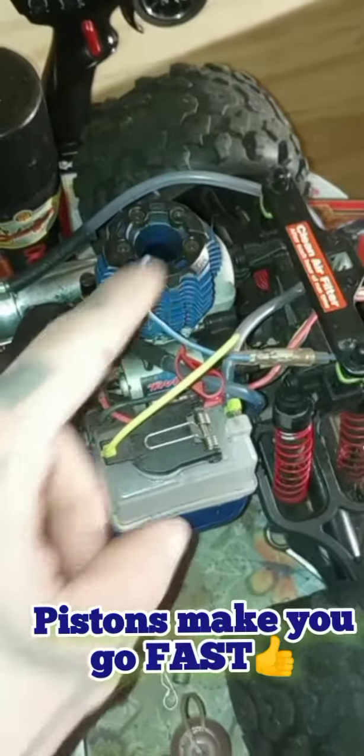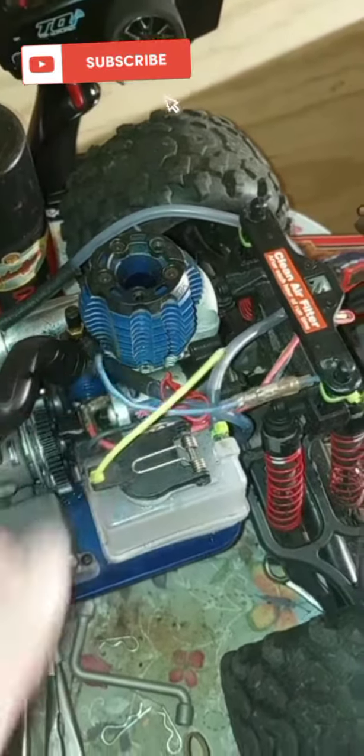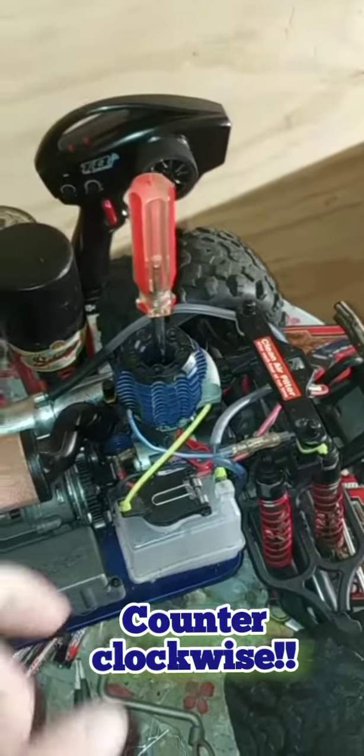Come over here to your head — this has your piston down inside it and your glow plug. Remove the glow plug wire, then get your tool of choice, go down onto your glow plug, spin counterclockwise, and remove your glow plug.